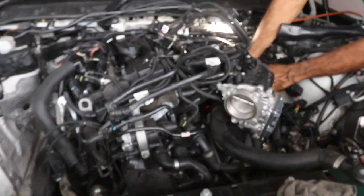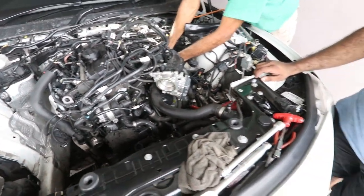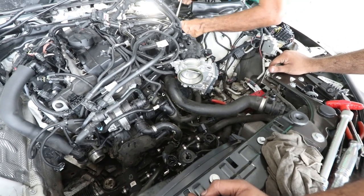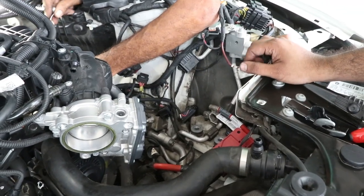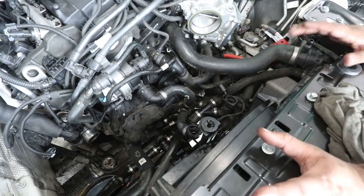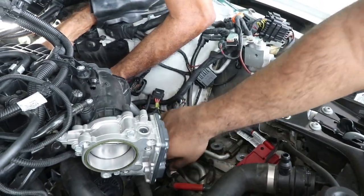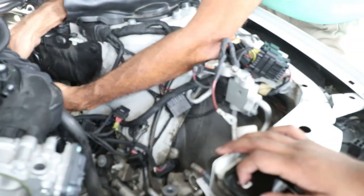Hi guys, so as you can see, a lot of things are out. Disconnect the high voltage battery, then we disconnect the normal 12 volt, then we disconnect the auxiliary 12 volt for the start-stop. Then, well, you do the coolant, take out the high temperature, low temperature, the two coolant bottles are removed, and now we remove the electric air compressor. The ECU was here, remove that as well as the holder.